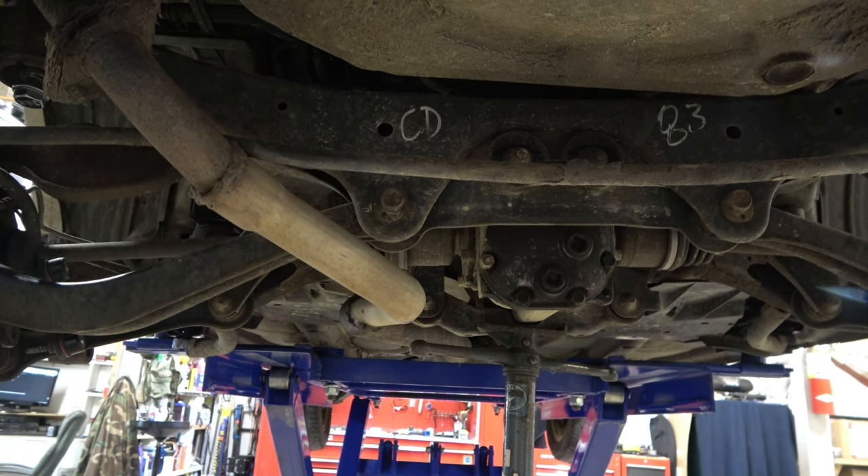With three of the four in place, if something were to go wrong it shouldn't go all that wrong. I will tighten up everything and we'll be ready to reinstall our struts. The double block goes back here and the single block fits right there. We're just going to hammer these down and it's time to tighten everything up. I'll do the same on the other side, then it's time to tighten the four subframe bolts. The top halves are already tightened — all four of those are tightened. Now it's time to tighten the bottom ones. We're ready to do this thing.